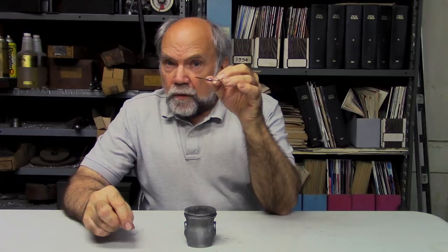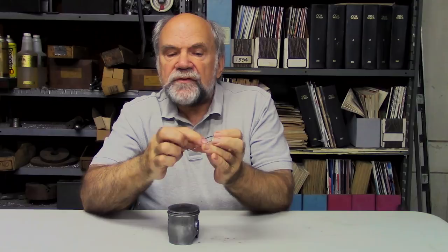When the combustion process is started by the spark and the pressure in the cylinder begins to rise, it flows into the piston ring groove across the top of the piston ring and presses against the inside of the ring uniformly, inflating the ring against the cylinder wall. The rate at which that gas flows into the ring groove is controlled by how much clearance there is between the ring and the groove.